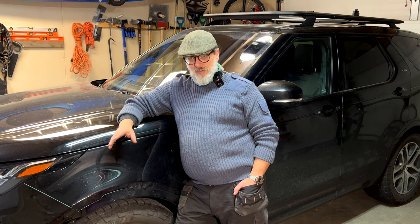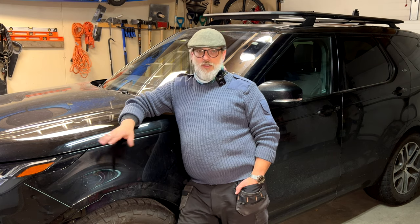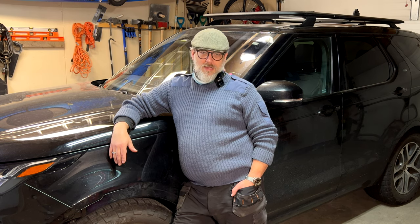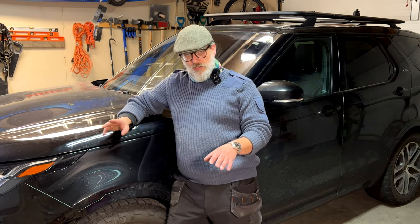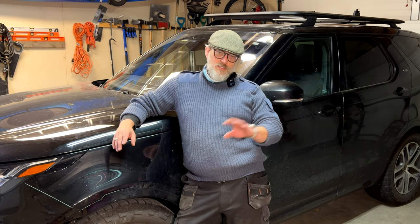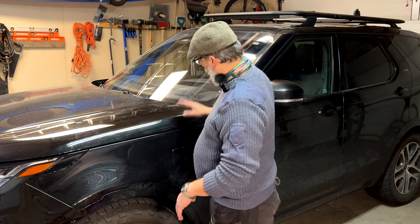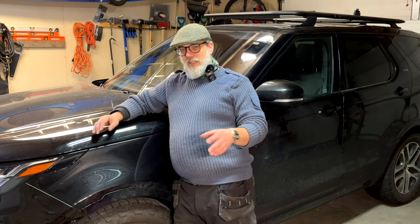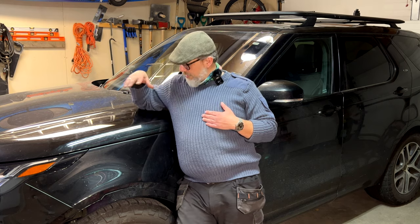And DEF isn't the best subject material in the world for certain kinds of materials, so it's quite corrosive to mild steel and aluminium. So these tanks and lines and all these other sorts of things have to be made out of the right kind of material, so that it doesn't turn into a big ball of mess. So what I'm trying to say is that this DEF system, although all we have to do as owners is